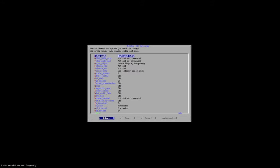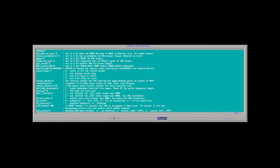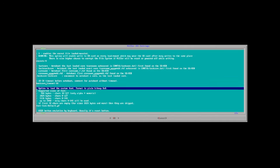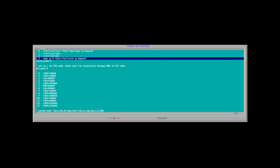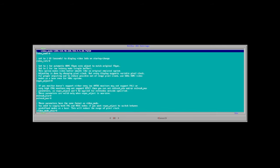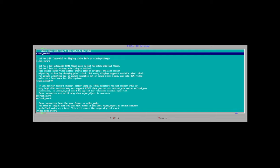And now it's time for the real magic to happen. Back in your INI file, go to advanced and scroll down until you find video mode. Take note that anything with a semicolon in front of it is just a comment — not an actual setting. Find video mode with no semicolon in front of it. This is where we enter a custom mode line that will double our vertical frequency instead of our horizontal.